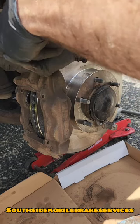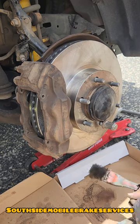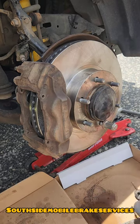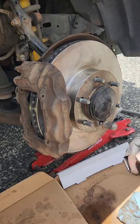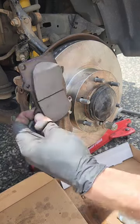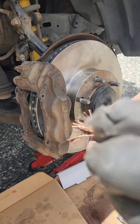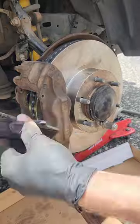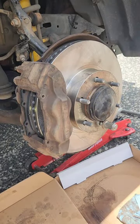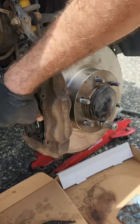You don't really have to put any loctite on these little bolts because there's not really any load on them, so that's fine. Give the guide pins a bit of a clean and make sure to get all the grime off — it builds up over time. Chuck the brake pads in, but before you do, make sure to put the tiniest little bit of grease or anti-seize on them because they do move. Not too much where you're going to collect heaps of dust and dirt, just the smallest amount and they'll slide straight over no problem.